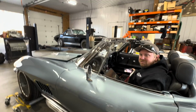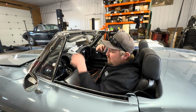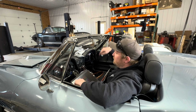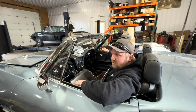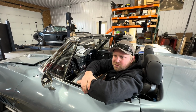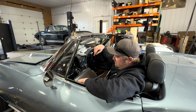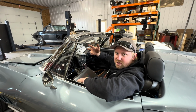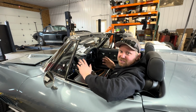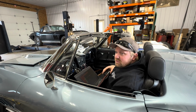Not bad. Almost 10 horsepower. Yeah. So when we dynoed it with HP Tuners last video, this side pipe was closed the whole time, even when we opened it, because it was getting hung up, and that one was open while we were dynoing. So we're within 10 horsepower of, I think it made 527, I don't remember. But we're within 10 horsepower of what it made with HP Tuners, and it's not lean. We have a little bit less timing in it, so I'm good with it. And now it runs, and I can work on it instead of not knowing what the heck I'm doing. So yeah, actually very happy with that, 517.